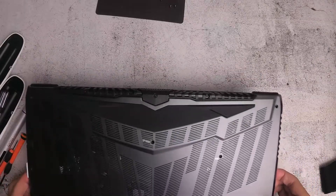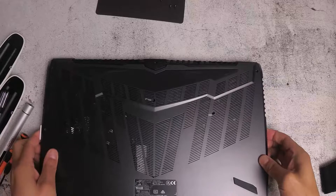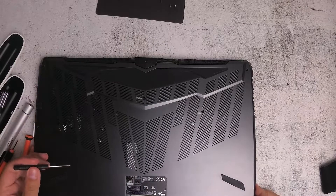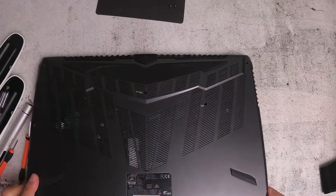Now the next step — you'll see that in the middle here there's actually a hole that you can use to push the keyboard out from the other side. We're trying to remove the keyboard because at the moment the back cover cannot be removed. There is a screw just underneath the keyboard that you need to remove in order to remove the back panel.